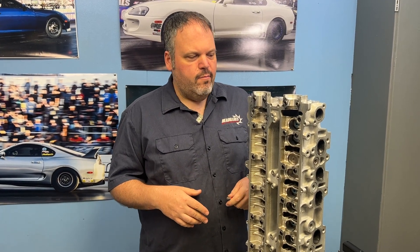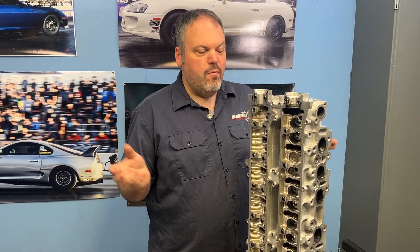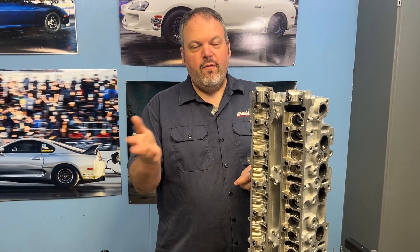I don't know where to go from here. Maybe we'll make a part two if we figure it out — but that won't be for a couple of months. I just really want you guys to see something you don't normally get to see: a world record-setting cylinder head. It still works. We're going to replace the buckets and replace the bent valves. The bent valves might actually be part of it — a bent valve won't move the way it should — but we didn't bend all the exhaust valves, so not everything's adding up.